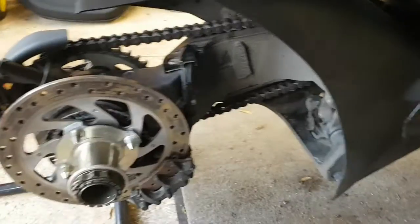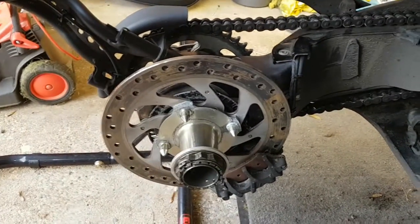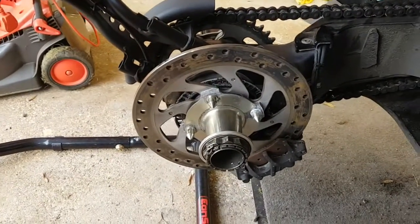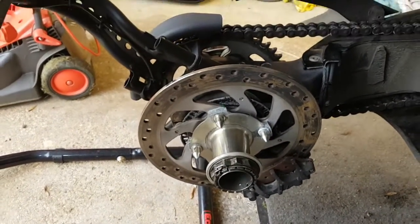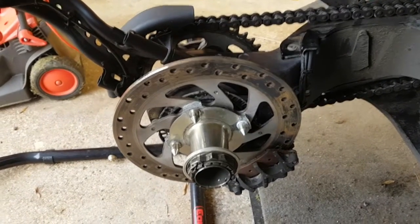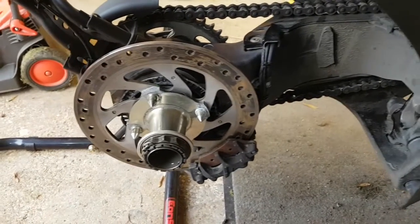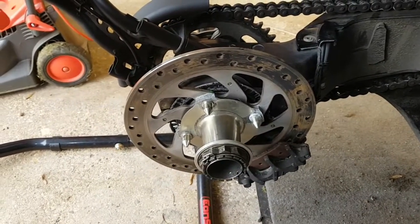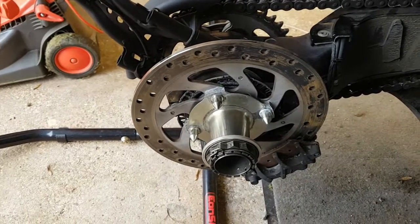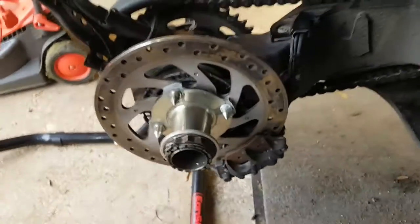So I decided that I was going to have to change these Rosso II tyres. 5,200 miles, and probably the last thousand's been a bit dodgy. The back tyre, as you may recall, was pretty much square. There was a good flat on that, and the front tyre, the road camber has pretty badly worn on one side, so it was really twitchy over painted lines and stuff like that.